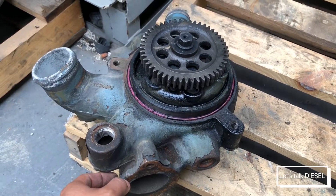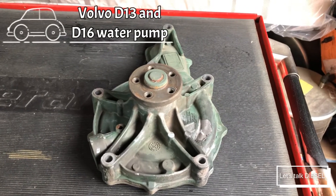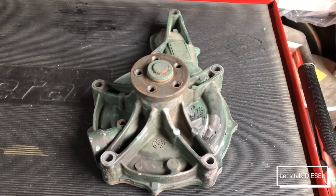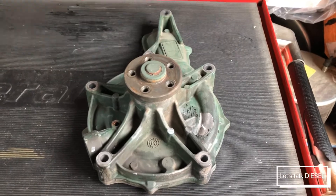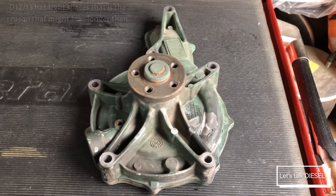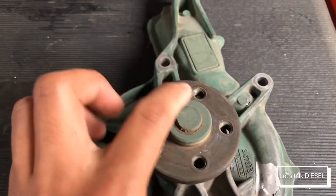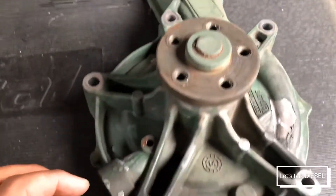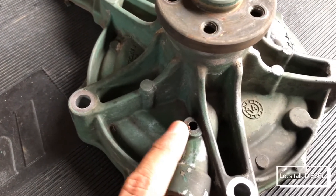Many drivers refused to replace it because it was really expensive. Now we have the Volvo water pump. Volvo has a simple design — this water pump is really simple to remove, but actually getting it out from there is another story because you have to remove the tensioners and a couple of things in order to take it off. This design from Volvo is quite simple. You see it does have a pulley, but you have to remove the part that goes on top of it because the core doesn't come with it. That spot in there is where it leaks the most.